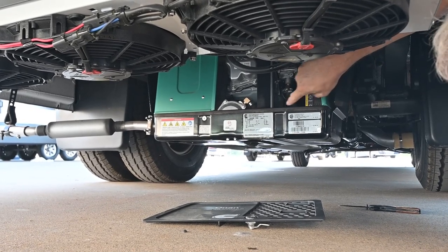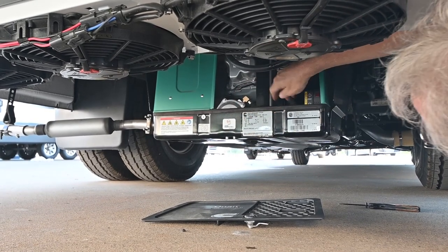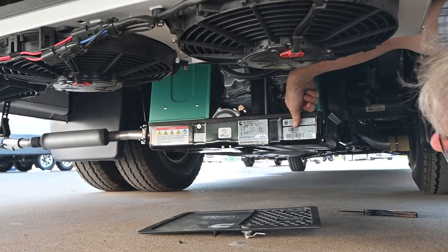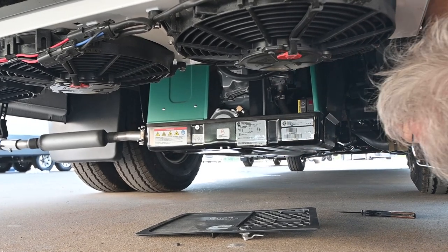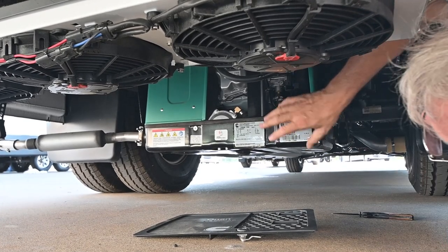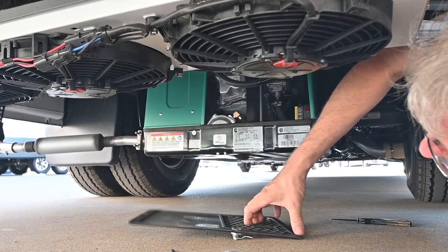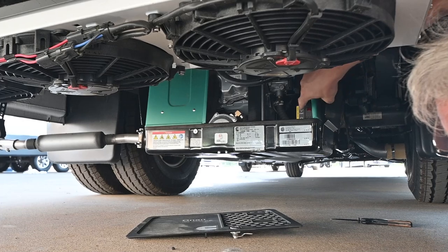There's also a circuit breaker in here — if this circuit breaker on the generator trips, I won't have any power switched to the inside of the coach. I'd reach down here and pull up on it right here to reset the generator breaker. Hopefully that never happens, but if you overload it — say you turn on the air conditioning, turn on the microwave, and it's charging the batteries hard — it could possibly trip. Just know where the breaker is and how to reset it.